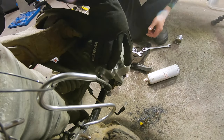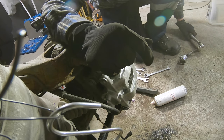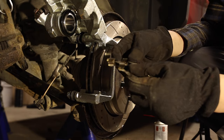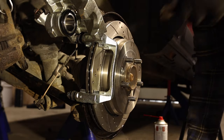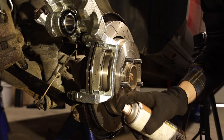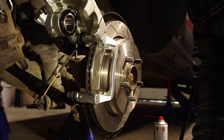Before putting in the pads, I'm going to torque up the brake caliper hose connection - the feed pipe. With that done, we can pivot up the caliper and get the pads in. First thing is to put in the sliding clips - I'm not sure what they're called exactly, but they're what the pads sit between and slide on. Then add some copper spray before fitting the pads.